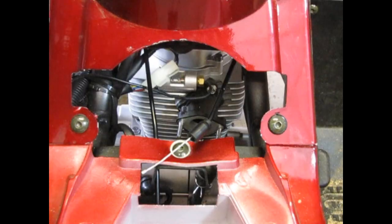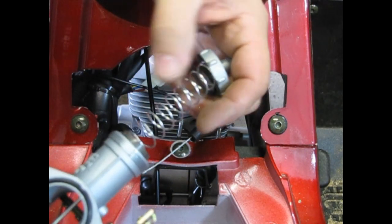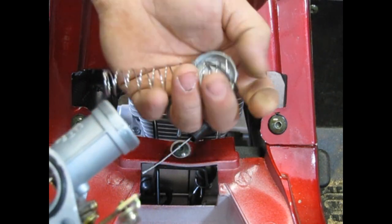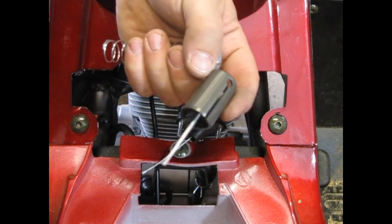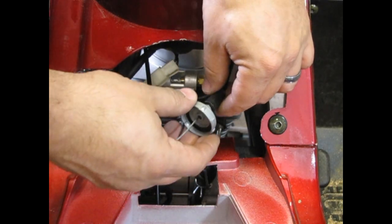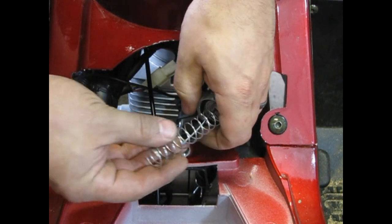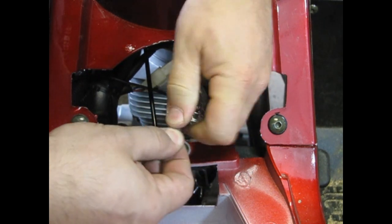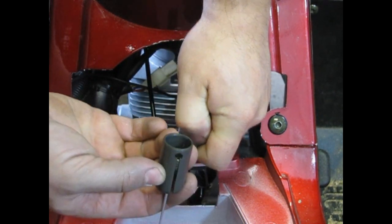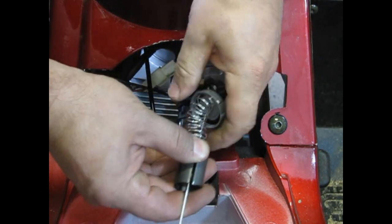Now from your new Mudify carburetor, remove the cap, hang on to the gasket, the spring, and the fuel slide assembly. Start by threading the cap onto the throttle cable, push it snug against the boot, and make sure the gasket's in place. Then slide the spring on, threading it all the way down the throttle cable, and keep it compressed in one hand. Then thread the throttle cable through the inside of the new slide assembly along the outside of the body and into the seat.